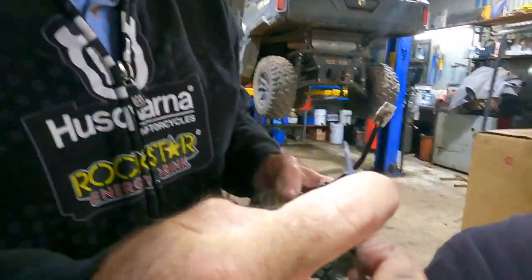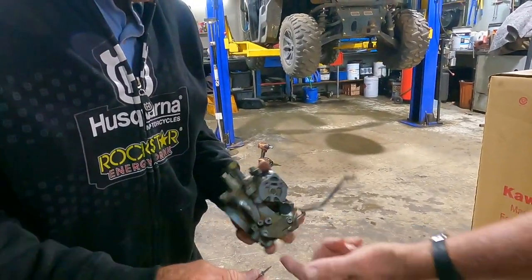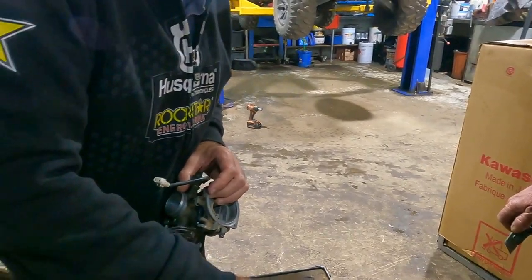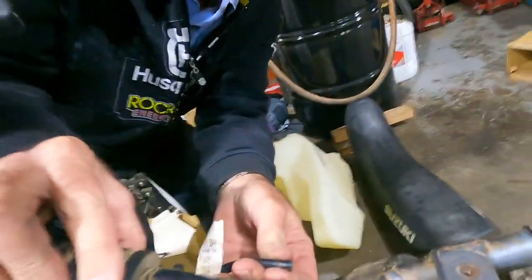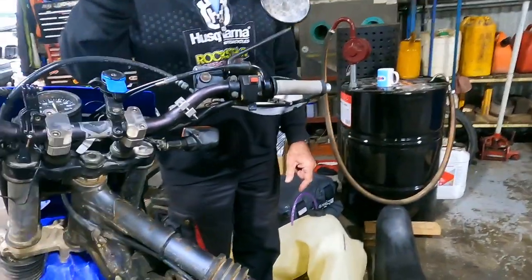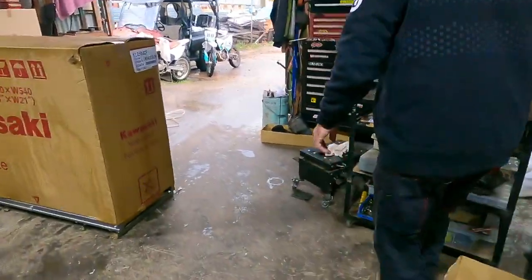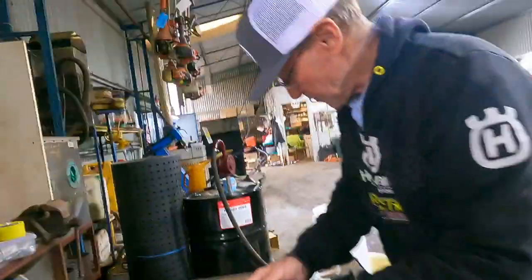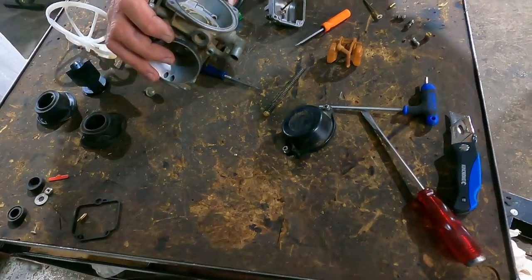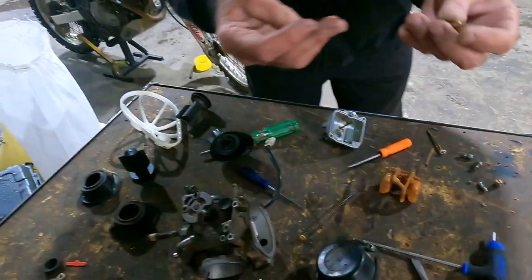Oh there we go — there's two washers. One's an O-ring. Now you can blow it out properly. There's an O-ring on top of there too. Oh, it wasn't there. That might make it run funny as well — it's very stiff, that would be leaking. That's terrible. Replace that — it's super hard. Get rid of it and put a new block up on the hose, bend it over just like that, right near the top. We can find an O-ring to go in here. Yeah, it looks like there hasn't been one in that spot. They run a bit ordinary without it.